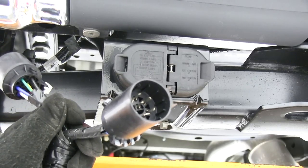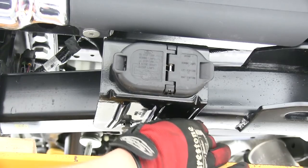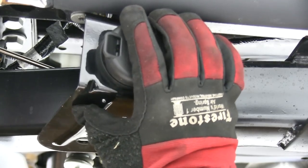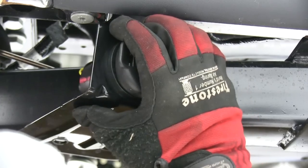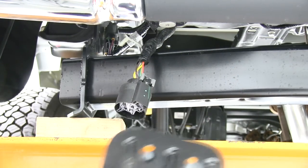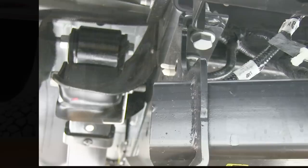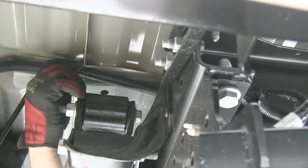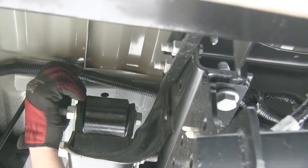To give myself a little extra slack, we're also going to go ahead and remove the plastic tab holding the wiring in place on top of the hitch. Then we'll press on the connector lock and disconnect it from the 7-pole. Now let's go ahead and route our wire over to the hitch, routing it up over the frame here along the channel of the bed. Keep in mind when routing your wires to stay away from moving components such as steering or suspension, or excessive heat such as the exhaust.